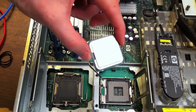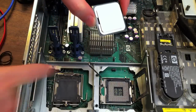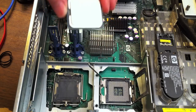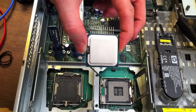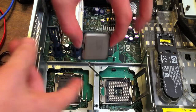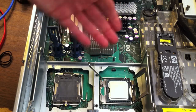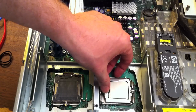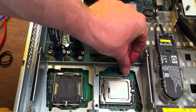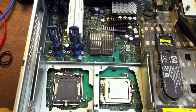So we're ready to toss it into the socket. If you notice, there's a little arrow on one end of the processor and the socket itself is cut on one edge, so it's very easy to determine what way to put it in. You'll also see a couple of notches, one at the top and one at the bottom, which correspond with notches in the processor socket. Once the processor's in, you just drop this down — you don't need to put any force on it at all. Take the lever, it feels like it's going to crack, it'll probably creak and make some noise — don't worry about it. Just chuck that thing down in there, put it in the tab, and you're done.